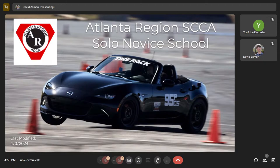If you did buy your own helmet, hopefully you bought the right one. Every so often we get somebody whose helmet is not. The biggest thing is no DOT rating, so that's like a standard DOT motorcycle helmet. Easiest way to tell is you can open up the lining and there should be a reflective decal in there that says Snell, and it either has an SA or an M. And it's got to be within the last 15 years. So that is essentially 2005 currently. It's going to be 2010 or newer here in another year. That's mainly because of the ratings and things like that. We do accept some EU designations and FIA and things like that, but Snell's the most popular.